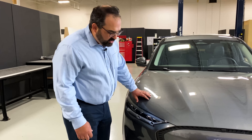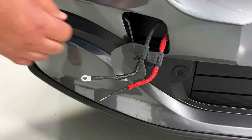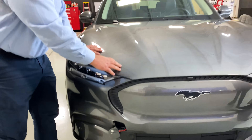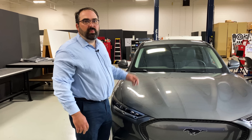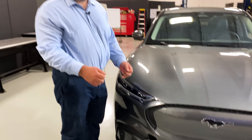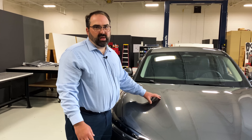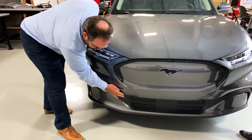One of the big things with this vehicle is there's no mechanical handle — there are push buttons on all of the doors. So if you get a dead battery, you can no longer open your door. What Ford has done is put a little hatch in the front fascia with a couple of leads that come out. You hook this up to a 12-volt battery or a jump pack, and this will release the frunk. The frunk can then be opened, and you can access your 12-volt battery inside, which would then need to be jumped. Once you get power to the 12-volt battery, you can open the driver's door and the remaining doors. We tried that this morning with a fully charged battery — we put some 12-volt on it to make sure it was secure, and it is. So if you go to the store, nobody will be able to come around and take your stuff out of the frunk.